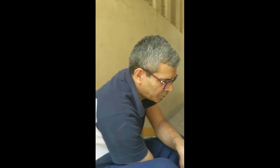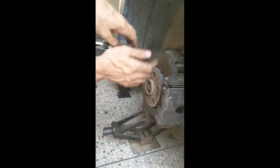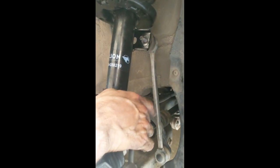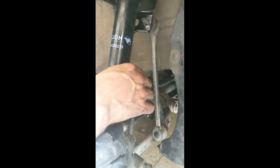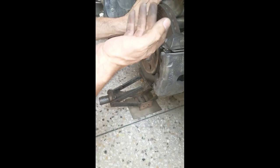As you can see I have put a jack below the rotors to lift the suspension mechanism a little upwards. Because this link rod, being old, is very flexible, so the entire weight of the suspension is on it and it doesn't come out easily. So by lifting it up I got some leverage and was able to remove this link rod with ease.